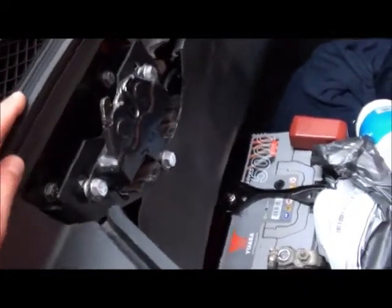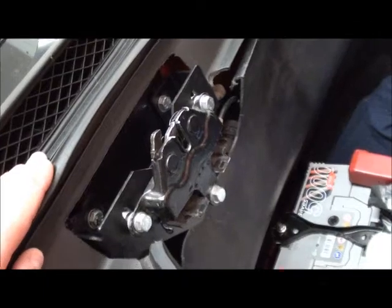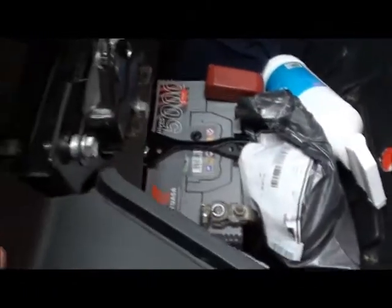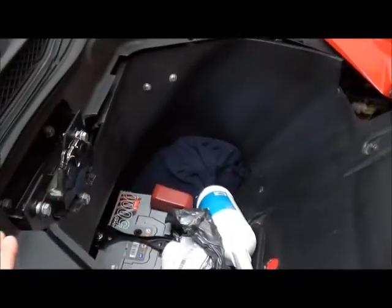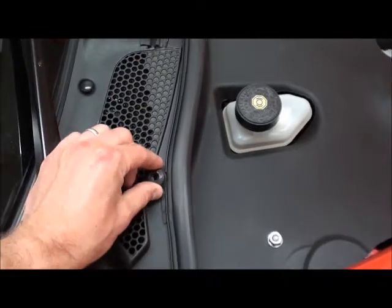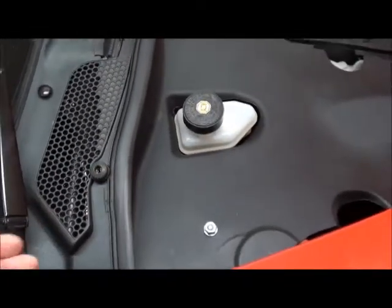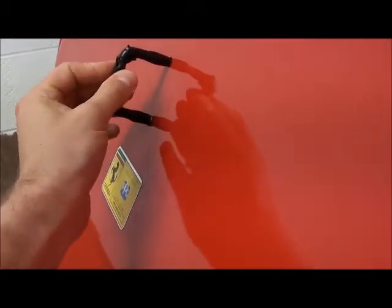Be careful here because you've got your VIN plate — the main one is in the back. Drilling these holes I actually got rid of some of the letters, but you can space it in and out with washers. It took me ages to get this right. Because that is metal on metal, when the bonnet shuts you want it not to flap going along. You've got bonnet stops here to push up against. It's a real trial and error thing. At the end of the day you want it tight fitting, but because it's metal on metal it might squeak. I've put rubber tape around here — it wears out over time but stops the metal-on-metal squeak.